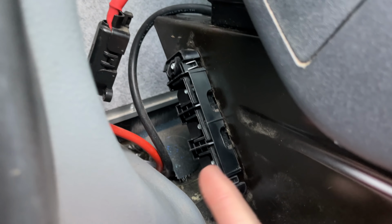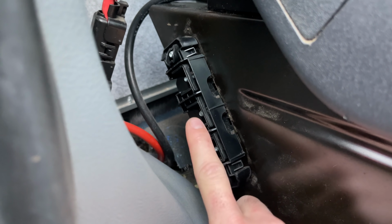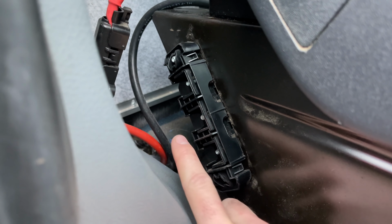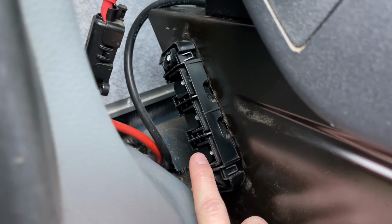Whilst I'm having two battery chargers, which are 30 amps each, to 60 amp, as I said earlier, one of these studs is fused to 60 amps, but 60 amps worth of battery charging will probably draw around 65 to 70 amps, which would blow one of these, so I'm going to run all three of them in parallel, so none of them are working particularly hard.